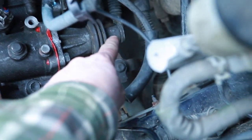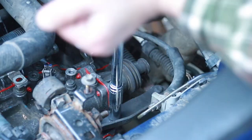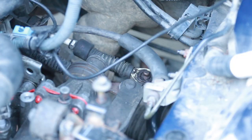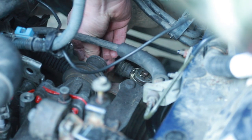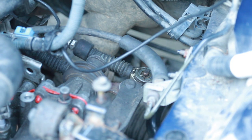Those two bolts need to get tightened. That little square piece just fits under there. That cable right there is gonna attach to the front. And the other one I've already slid on right there. I'm gonna go ahead and slide some of the rest of those things back on. And there's gonna be a retainer washer and a little cotter pin that holds it all in place. So washer, it's a small pin. Washer, pin through the hole. Right. Retaining washer, and here's that little retainer pin. There we go, she's not coming loose anytime soon. Both of those retainers in there. I should be able to go actually shift inside the car now.